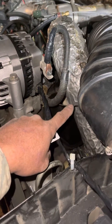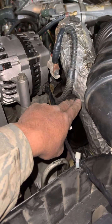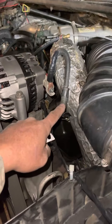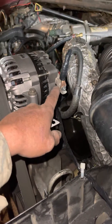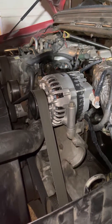If you have a new alternator or your batteries were dead and not charging, it could be as simple as one of the 5 amp fuses in your fuse box. In my case all my fuses were good, so I believe there was a break in the wire somewhere in the harness that I couldn't find. I bypassed the wire and now I have voltage to the exciter wire when I turn the key on.